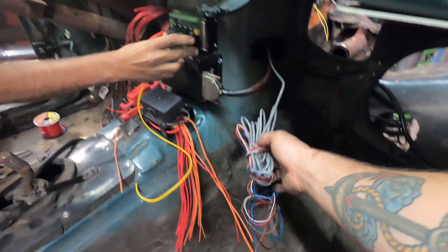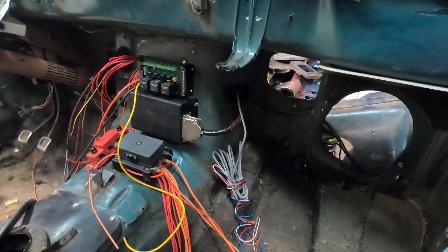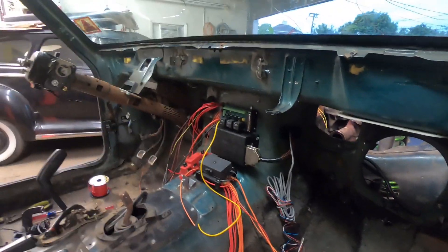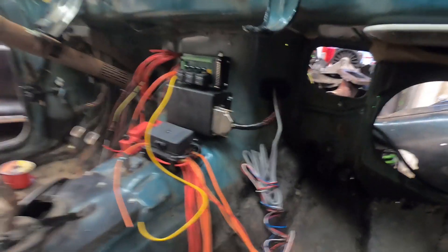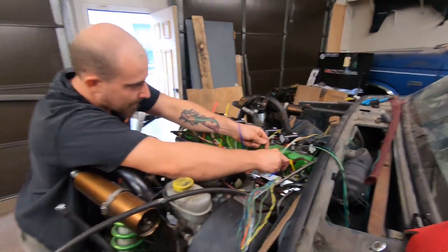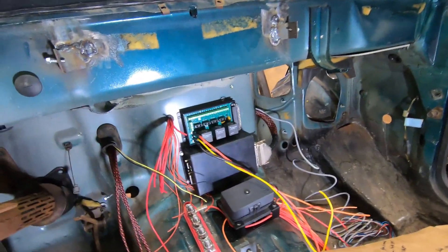We pulled the O2 sensor wiring through — it's going to the gauge and also to the Mega Squirt itself. The nice thing about the wideband O2 sensor we got is that it comes with its own controller, so we don't have to play wiring games. We can hook it straight into the Mega Squirt. There's just a sensor lead and a sensor ground to hook in, and we can keep the gauge for reading AFR. While Jeff works on the coils, I'm going to start tying all these wires into our relay board.